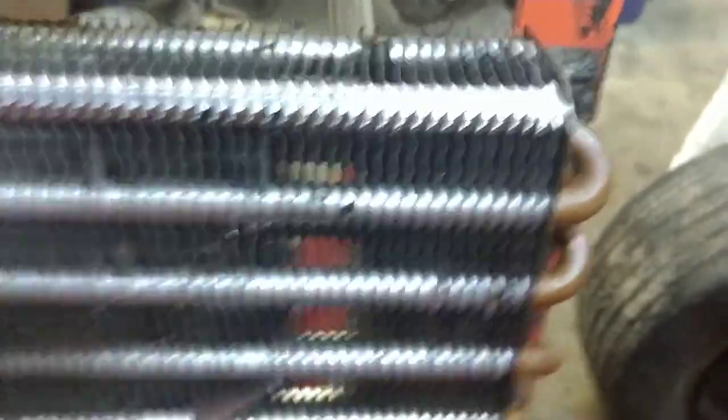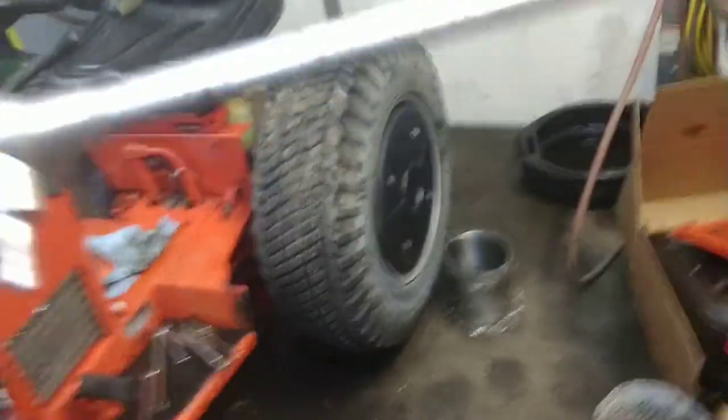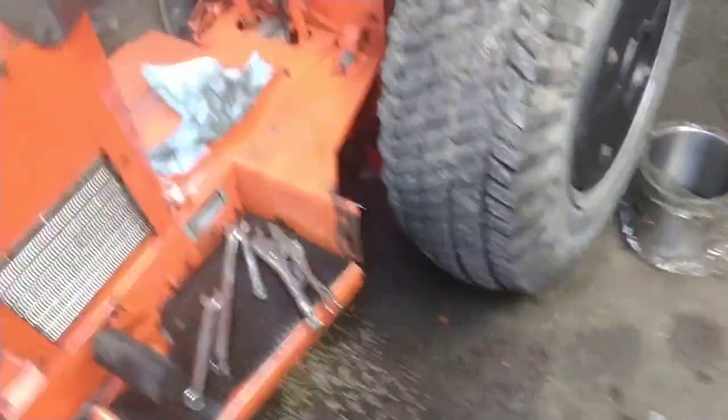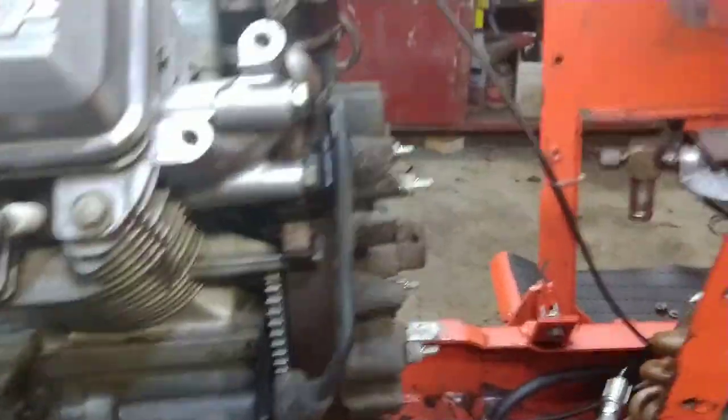See how you can see through the cooling fins here — you couldn't do that before, completely clean. What I do is I like to hit it with the power washer in warm weather, but in the cold weather like now I use kerosene and let it soak, then air it off. I got this really cool gizmo — it's an extended air gun with a siphon hose with a suction end on it. You just put it in a container of kerosene and blast away. It's too cold to run the power washer. Look at how clean this is after the kerosene bath.